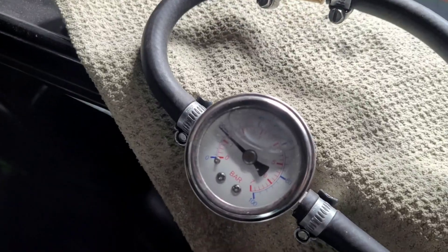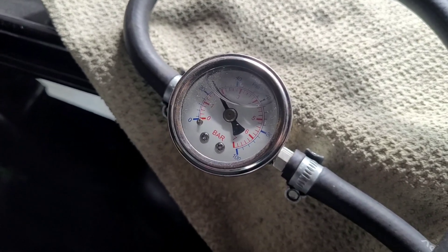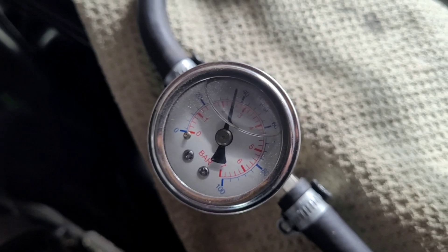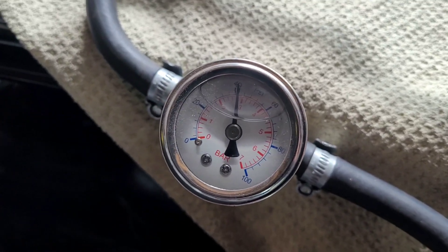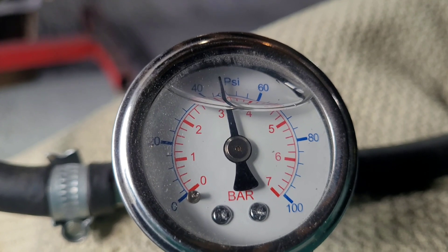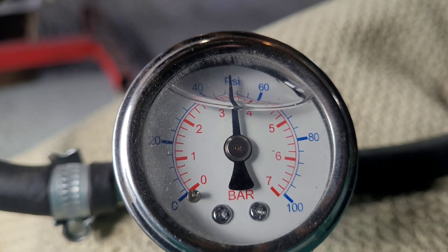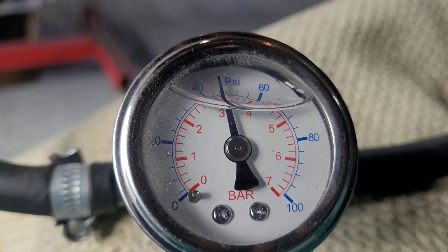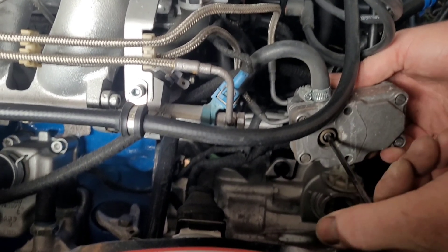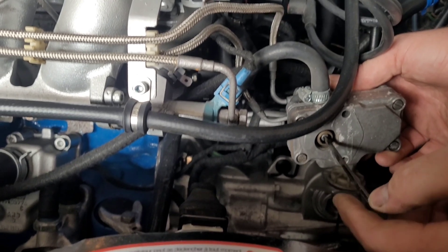The car's idling now from cold — you can see on the gauge it's sitting about one bar and a bit. As you can see the gauge is rising as the engine warms up; I think it was about two minutes 15 seconds all the way up to where I've got it set, which is three bar. Now I'm screwing the allen key in and you can see it's increasing the pressure — then adjusting it back out, returning the pressure to where I had it set. Turning it clockwise increases the pressure; turning it anti-clockwise decreases the pressure.